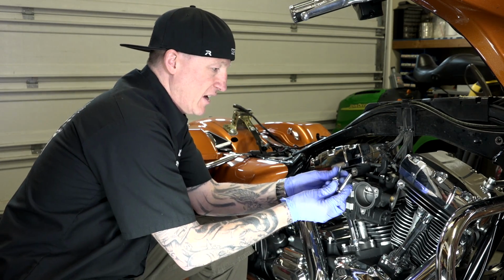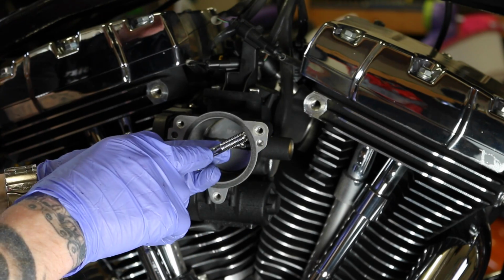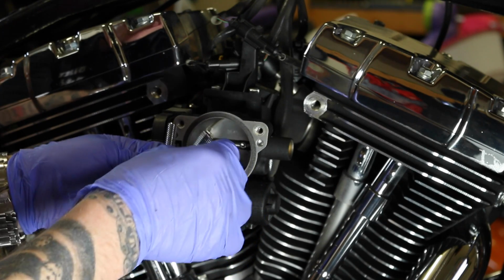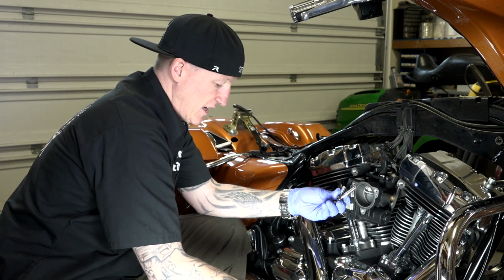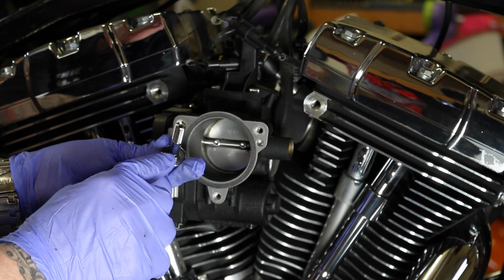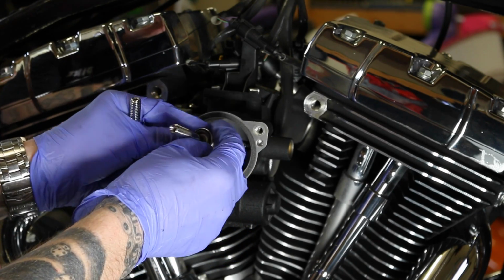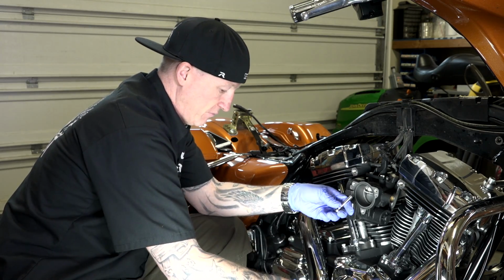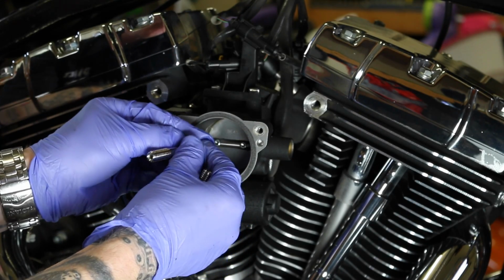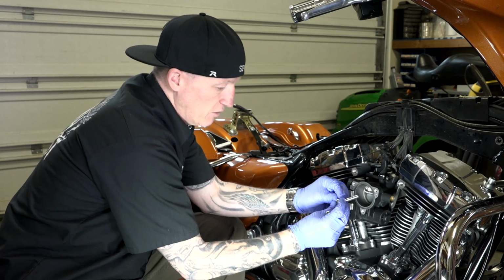Next, you've got the two big, basically crank breather bolts here, guys, and you'll notice that it's the ones that have a hole in it. You'll see the hole there. They're pretty large, and so what I'm going to do on these right now is take an O-ring, and that O-ring fits right down into there, guys. So make sure you press it down in like so. I'm going to do that to both of them. Work it right down into there so it seats real nice. Okay. And I may have to do a little more there.